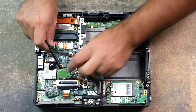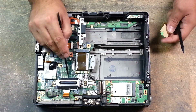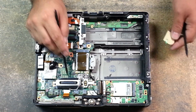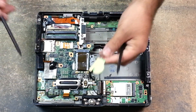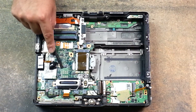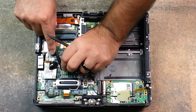You have to be very careful. Just do it on the very edge. There's a white line here that outlines your CMOS battery — it outlines this whole thing here. Just get it under the very edge and lift up, and then use your fingers to lift it away.